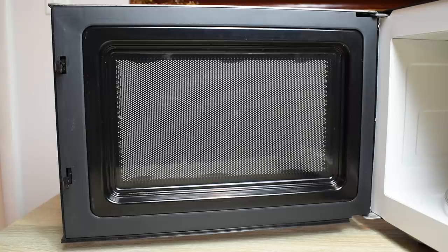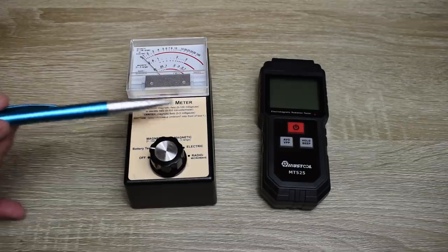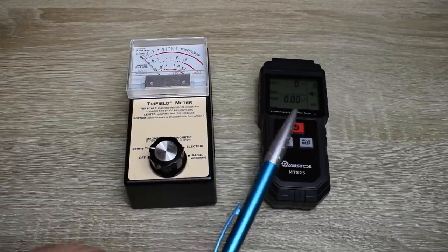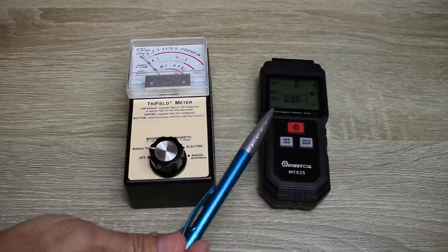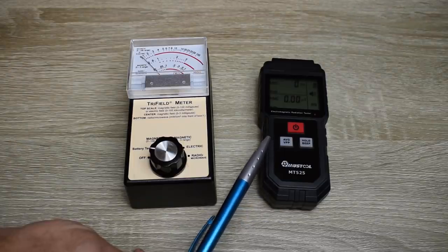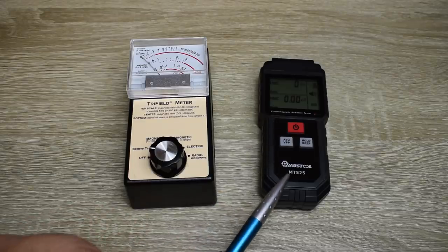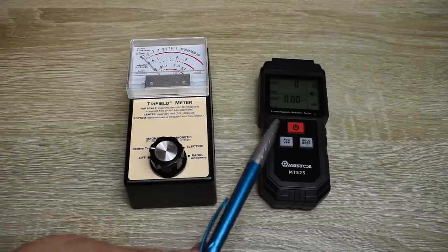Let me show you what I'm going to be using to perform the test to ensure that we have accurate results. In the past on my channel, you saw me use this tri-field meter - it checks for electromagnetic, electric fields, and radio waves. And you saw me use this electronic tester made by Mustool, which looks for electromagnetic fields as well as electric fields. The problem with this tester is it's not going to be good for checking leakage on a microwave oven, because it does not do a good job at differentiating between electromagnetic energy and a radio wave. You can bring this close to the microwave oven and it may pick up the electromagnetic field from the circuit board mounted transformer or even the high voltage transformer inside the microwave oven, and it's going to skew the reading. So you're not going to know if the reading is from microwave radiation or from an electromagnetic field.